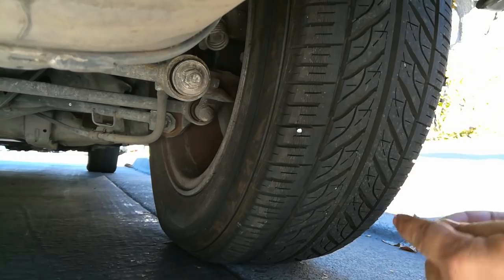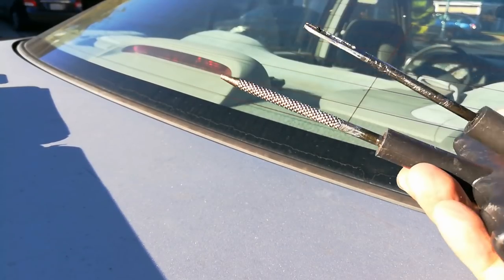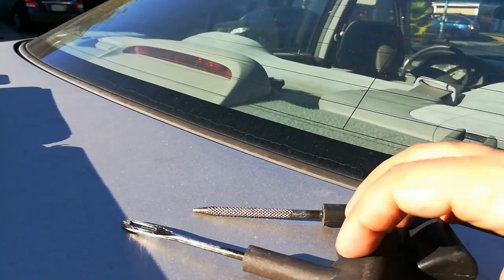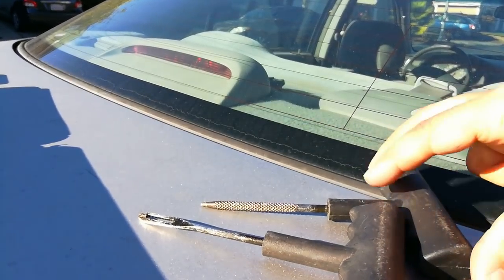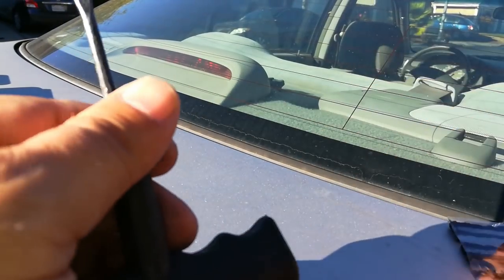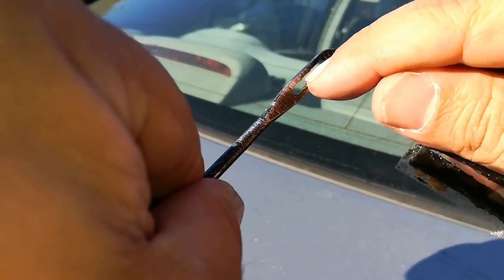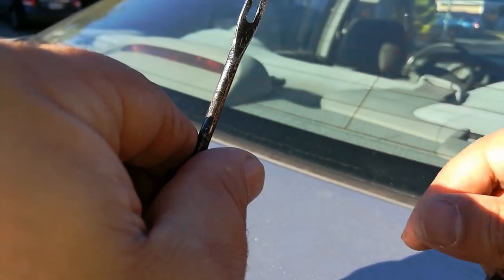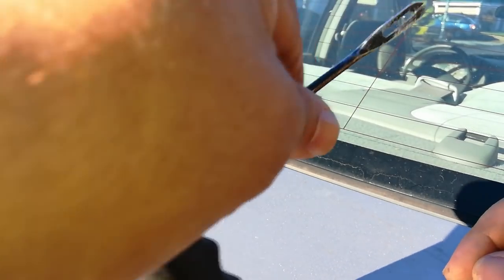Before you pull the nail out, you want to make sure everything's loaded. To do this, what you're going to need are these two tools — I'll have a link below if you don't know what they are — just a tire plug tool and some of the inserts. I'm going to use this to file down, and then this is going to take the plug and I'm going to insert it right in the middle, equal ways on both sides, punch it inside the tire, then take one quick swing and pull this out.